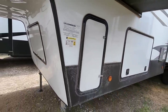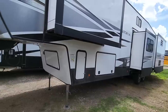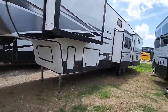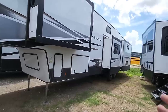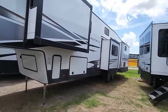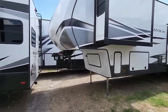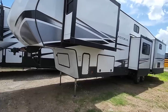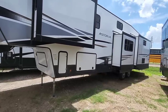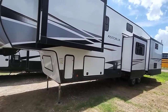Just like a pickup truck — and I've mentioned this in other videos before — the axles on your trailer are essentially the equivalent to the rear axles of a pickup truck. The front axle of your trailer is the back axle of your pickup truck, and not one axle is designed to carry the entire weight of the vehicle. Your axles and tires on an RV are only designed to carry the weight resting on them at any given time. The front of your RV is going to transfer a significant amount of weight to the back of your pickup truck, which acts as the front axle of your RV. I always get comments wondering why the axle capacity doesn't match the gross vehicle weight rating — go look at your pickup truck and you'll see the same thing.